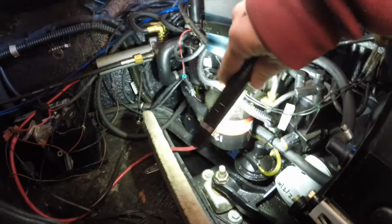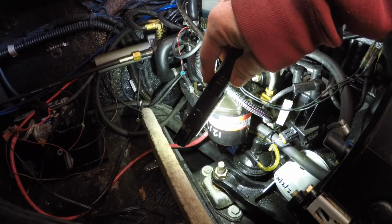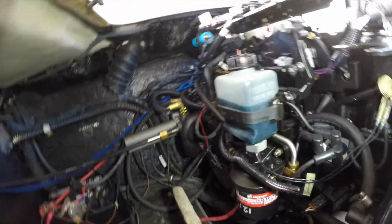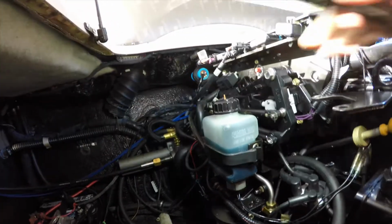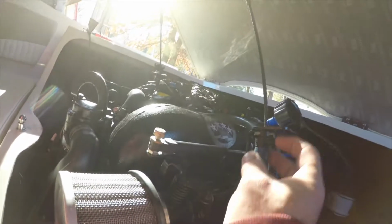Then I'm going to take a picture of my fuel filter down here. Mercury 3586659 4K01. So we need to change that filter. I need to change the fluid here. Change the oil. Pulling the dipstick, putting the tube on that. Yeah, and with these, all you gotta do is release, and then I think these pop off. Maybe I'll pop these.